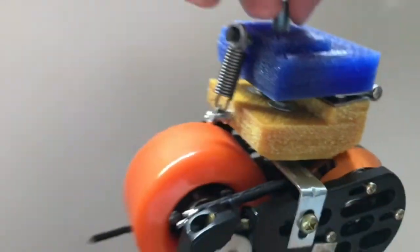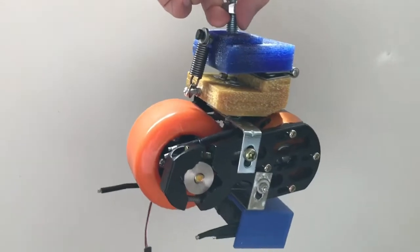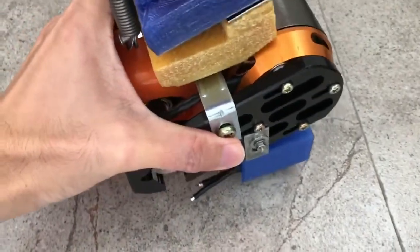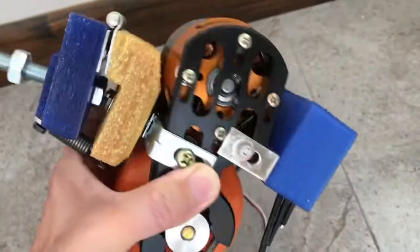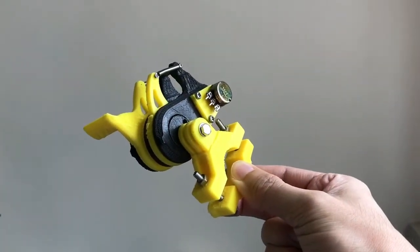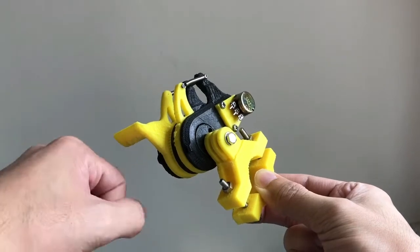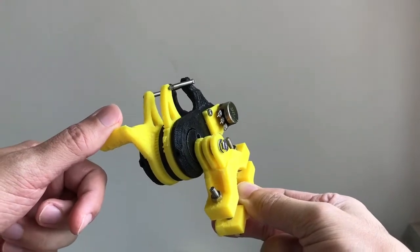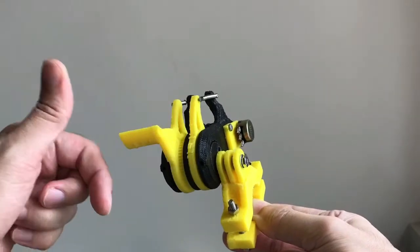The whole weight is supported by the 10mm board at the top. At the bottom here you see another 3D printed structure — it's an ESC tray, not only to hold the ESC in place but also to protect all the weight from squashing against the electronics. Now what I have here is a 3D printed lever throttle control. Unlike the throttle grip control system on an e-bicycle, this throttle lever system is similar to those that you find on an e-scooter. To increase speed you just press down the lever, and to slow down you just release. If you release all the way you get zero throttle.